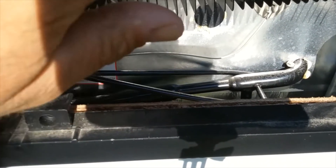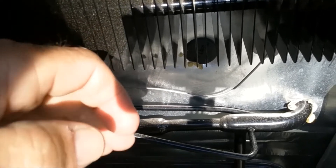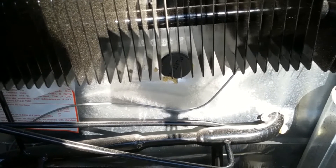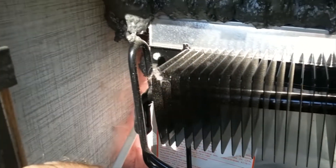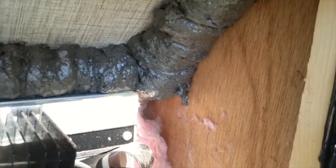There are two more modifications that will help these refrigerators work better. The fan will be in the upper vent area pulling air out, but the problem is the open space between the coil and the side wall — air always takes the path of least resistance. Our main objective is to cool the coil, so the first thing to ensure is that everything is sealed up good inside the refrigerator compartment in the back.